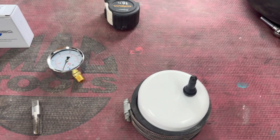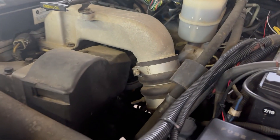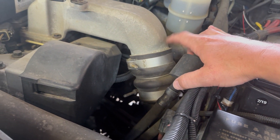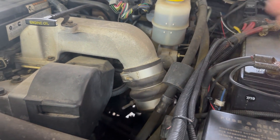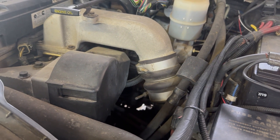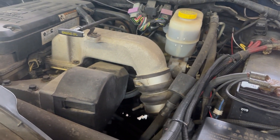A lot of engines you're probably going to have to cap the air intake side as well, just because it will bleed out past the intake valves and that kind of stuff. The Cummins, you shouldn't have that problem at all. Worst case scenario, if you have a gas engine especially, you're probably going to want to pull a coupler at the intake, measure that as well, and get another cap. The caps range from a couple bucks maybe up to seven or eight dollars per cap. Either way, it's going to be a lot cheaper and a lot easier, and that'll pressure test the whole system — intercooler and everything.